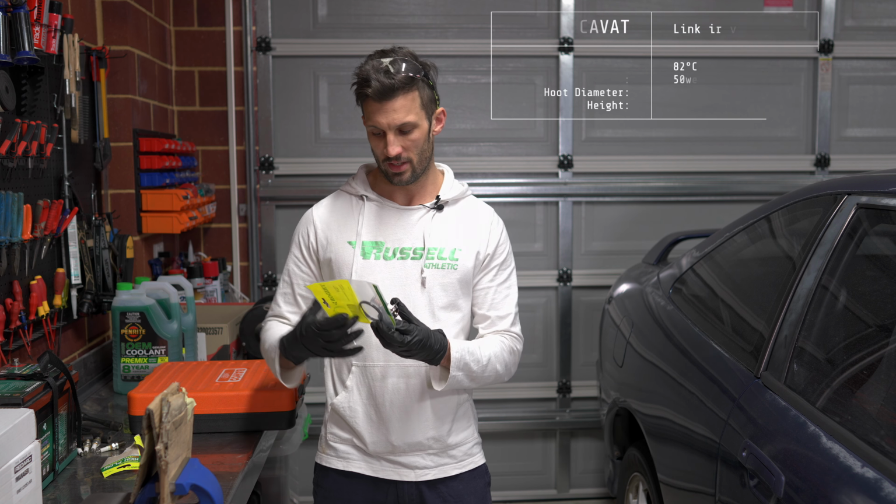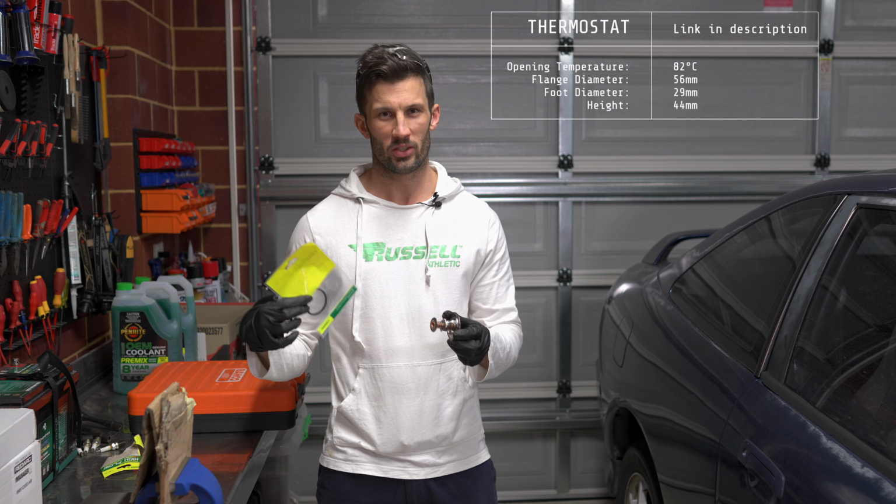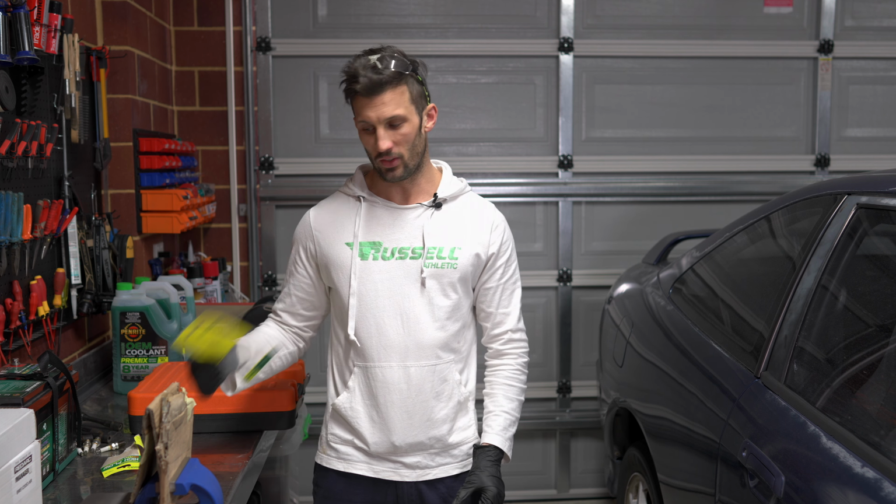We're changing a thermostat over. If you want to do it, it's a good time to do it if you're doing a coolant flush at the same time, so I'll make this video quick. If you want to see how to drain the coolant and do the coolant flush, there'll be another video up that way, I think. So we need a thermostat, and you may or may not need a thermostat gasket depending on your car, but in this case we're going to use a gasket.